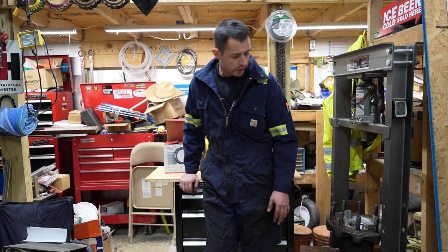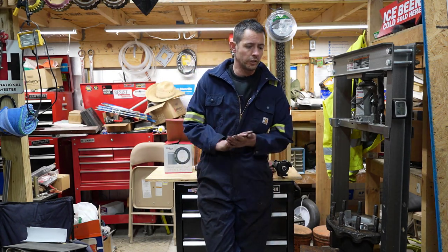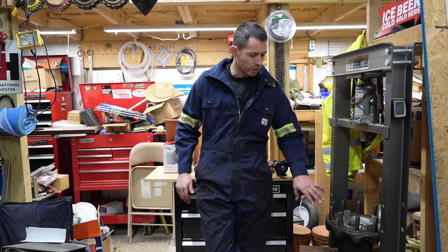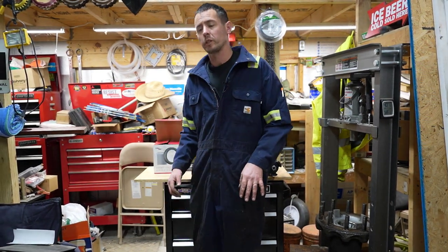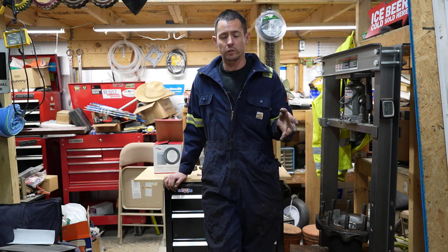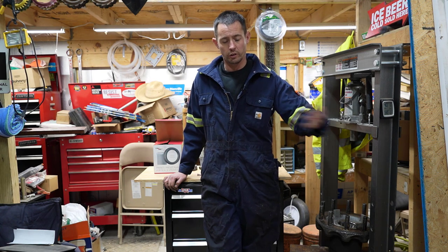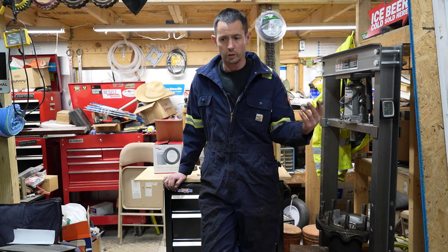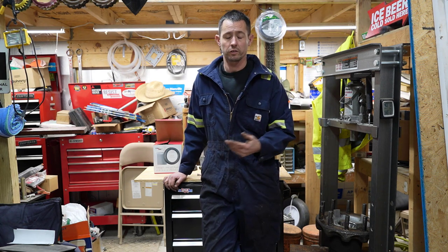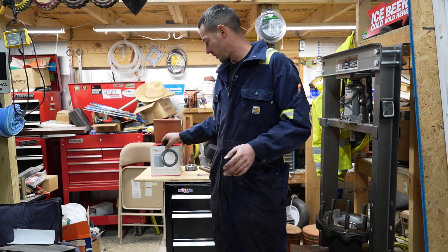All right, so I've got the races pressed in here, and that pretty much concludes this job. This truck has a Con Met hub, which typically has a spindle spacer in it. When I took this one apart, it was missing the spacer, which you can run without. You just do your end play or preload, the TMC RP 618 procedure. With this, I went ahead, as I like the spacers and the preset hubs myself.